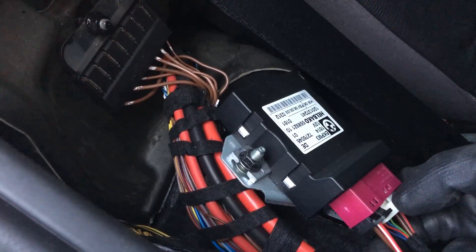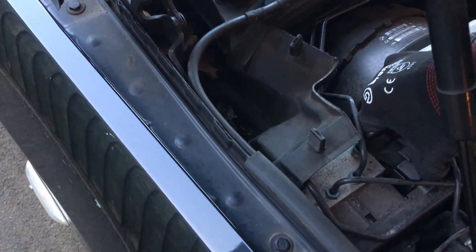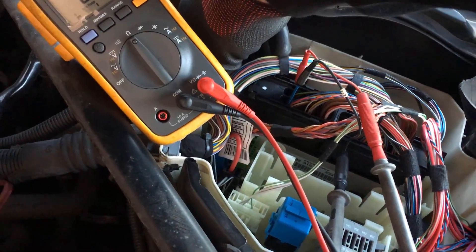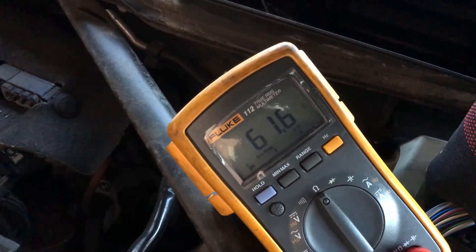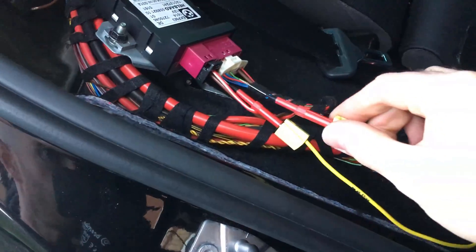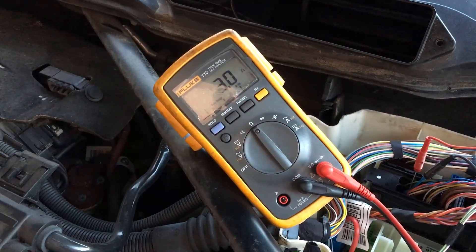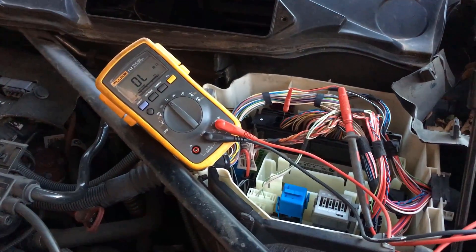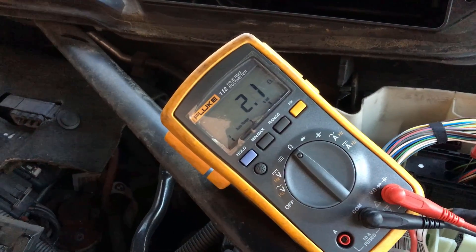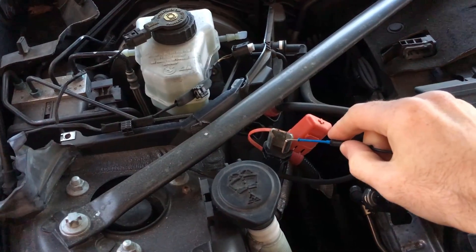When we disconnect the EKP or the ABS module, we read 120 ohms on the resistance check. However, if we disconnect the engine control module, we still have around 60 ohms with only a small change in the resistance reading. If we short the network together, we get a reading much closer to zero ohms. And if we short the network to ground, we can measure the resistance between the CAN line and ground to diagnose the fault — a similar check would apply for a short to positive.